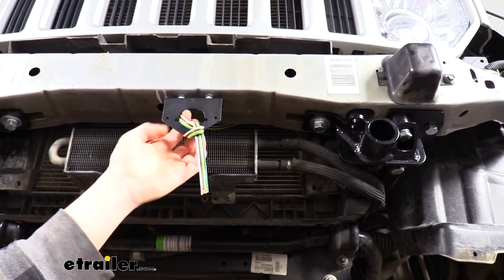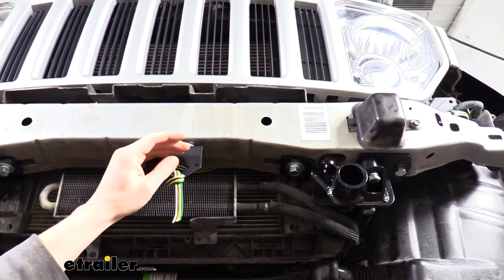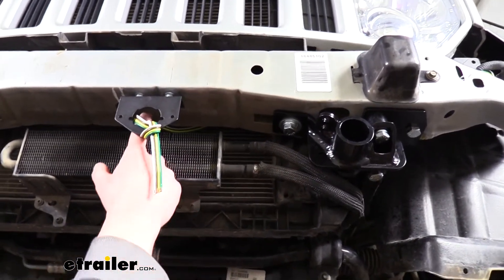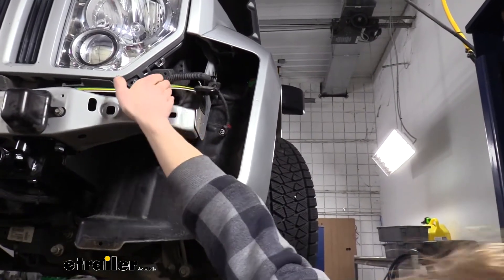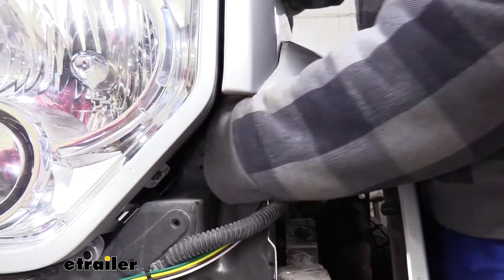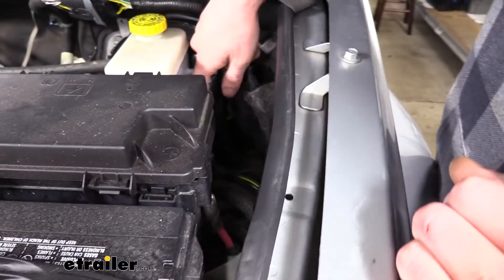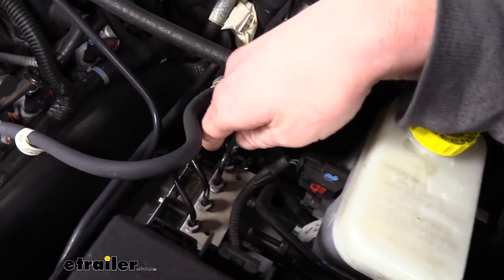We then began routing our wiring. I started by tying a knot in the front to leave a little slack so we can easily pull the connector out for repairs or future additions — there are a couple of extra pin holes for additional accessories. The rest of the wire routes toward the rear: we come behind the bumper, on top of the bumper, over to the right under the headlight, zip tying to factory wiring along the way, then up through the bumper, past the headlight, and out next to the battery.